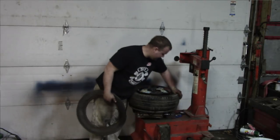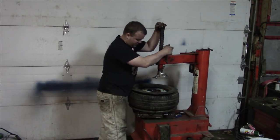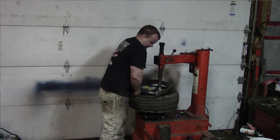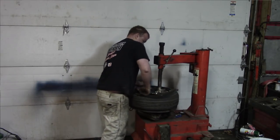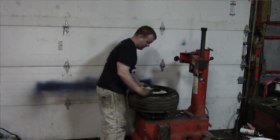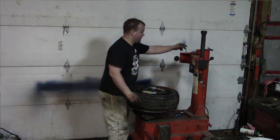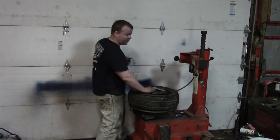With the outer bead popped, just peel the tire down. Take this new outer rim and just place it on there, just as if you were going to put a tire onto the machine, and just put it on — just like any other tire. This is a lot easier than doubling. Now you just want to center the outer rim. Because it's not an actual rim, it requires a little bit of work to center. Once it's centered, put your stem back in and then add your air. That's as easy as it is to put these outer tire protectors on.